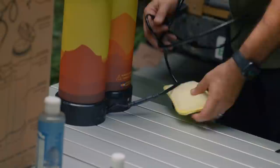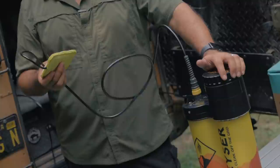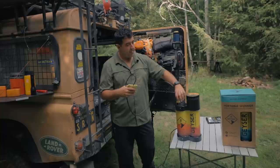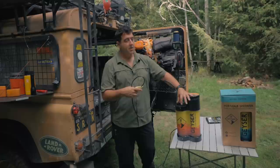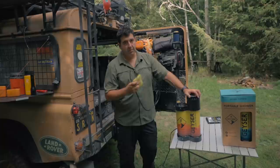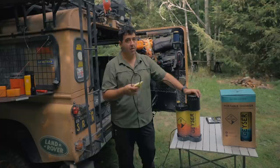This is the heated unit. On our test it was a hundred degree day - we put in about 75 degree water and it took 20 minutes to get up to 95 degrees using the heater. It drew about eight and a half to nine amps and took my battery from 100% down to about 97%, then to about 95% on a second go-round. Due to some sensor issues with their thermostat, it heated once and then we couldn't cool the thermostat down to do a second heating without putting ice water in it - so really effective for one heating but not good for two. Also, unless you have a secondary battery, it could jeopardize your starter battery if you're not running the car.